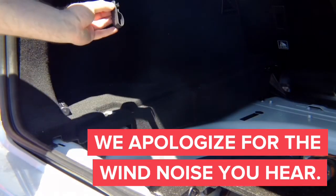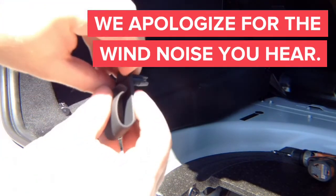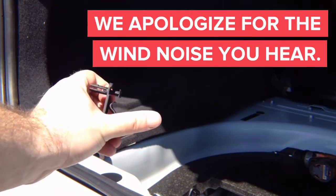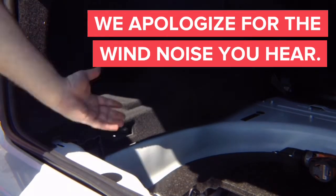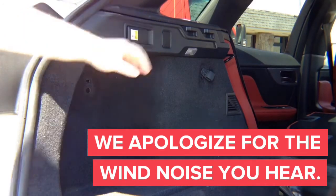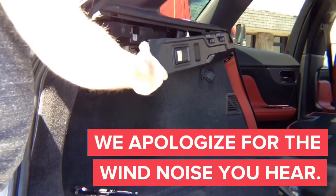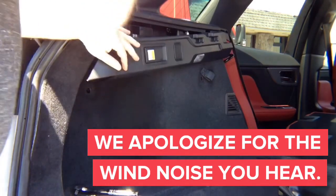On the side here you've got two of these clips — take care to remove them. There's a piece that you just slide out with a tool, carefully. You've got two of these on the sides, one here and one there; they just slide out. Then remove the top cover that's covering the door on top. Remove the screw located behind the handle. After you remove the screw, you'll be able to just pop out this panel — it just pulls out. There's a release that you release; you can either move it out of place or remove it completely.